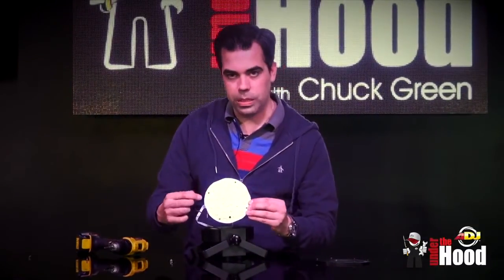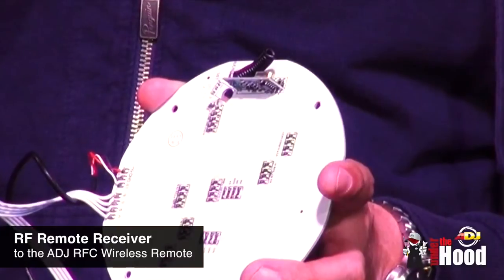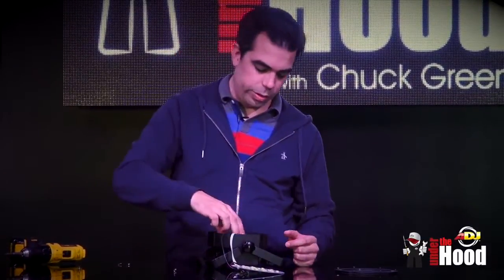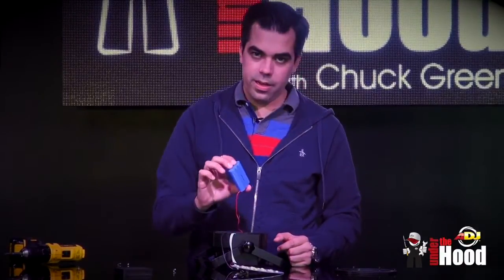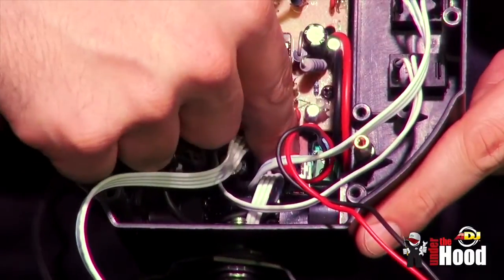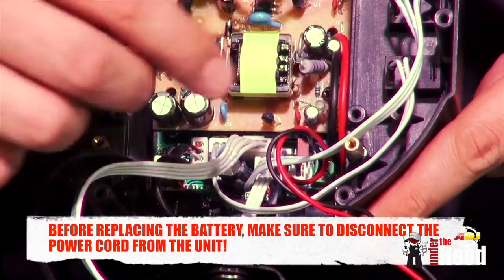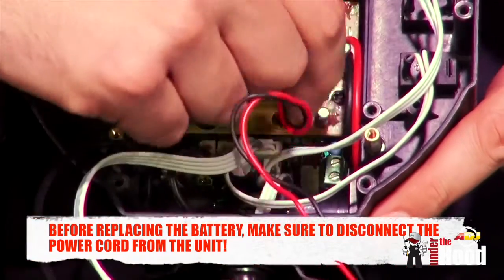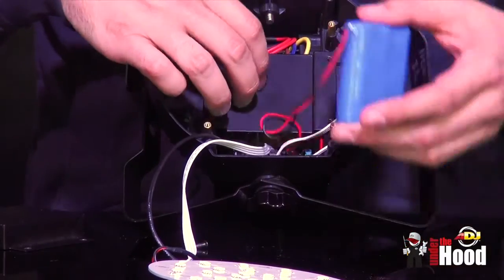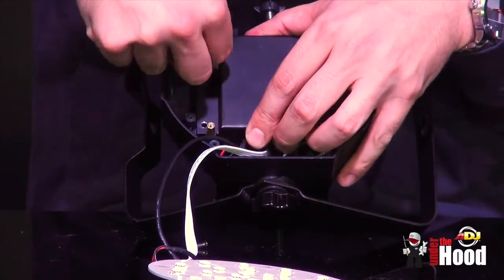I've got the board out with the 27 SMDs on it. On the back you'll see this little curly pigtail — that's the RF remote receiver for the ADJ RFC wireless remote. After pulling the LED board out, there are four screws and you take this metal piece off, and there you have the lithium-ion battery. It's real important: don't replace your battery if the light is plugged into the wall — make sure your power cord is disconnected. Just reach down and pull it out; it plugs right back in. Then put the plate back, battery rests on top, put the next plate on, and screw it back together.